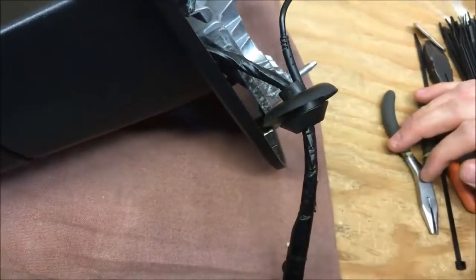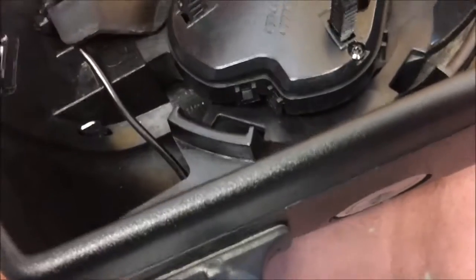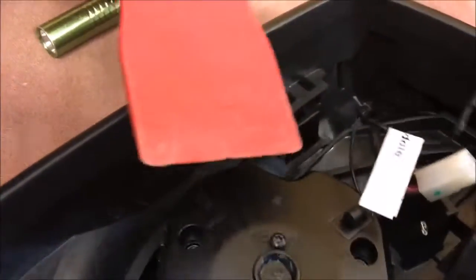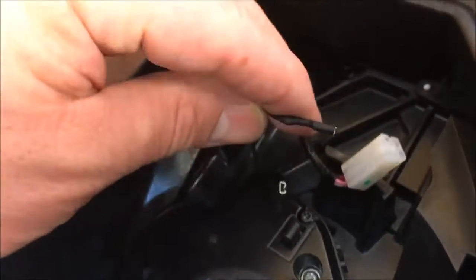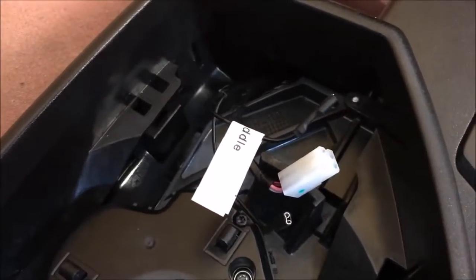Be back shortly. So one other thing to note, this glass just kind of latches on around this guy. So take your pry tool, get in here and pop, pop, pop, and that'll come off. Then it's got some connectors, make sure and mark before just removing it where it's gonna go back to. And these guys, you're not gonna just be able to tug off. I had to take a pick, kind of get in there and pry it that way, give it some help.